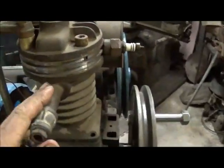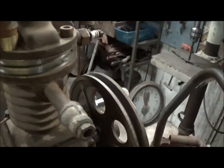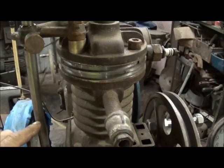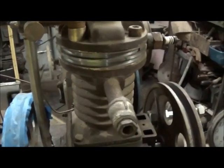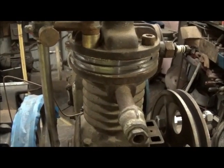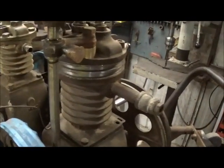They don't run a carburetor - they run a fuel mixer. The fuel mixer is basically just a Venturi with a needle valve. You make it adjustable to set your fuel. For firing, we're going to use possibly a roll pin or just a tab with a set of points. You can fire it off the cam, which turns half speed of the crankshaft, or you can fire it off the crankshaft. If you fire it off the crankshaft, you get what's called wasted fire - it fires every rotation but only uses it every other rotation. It doesn't really matter at all, doesn't hurt a thing. You can pretty much time it any way you want.